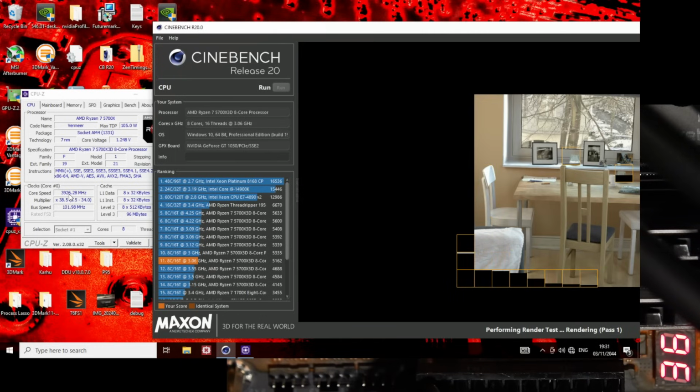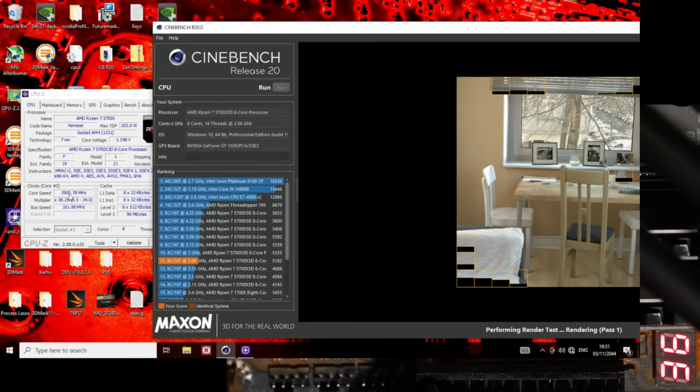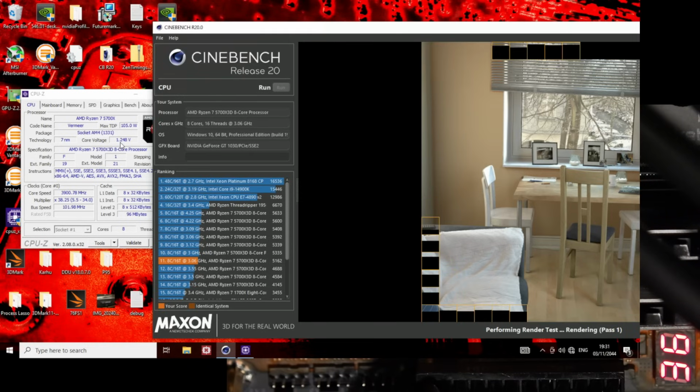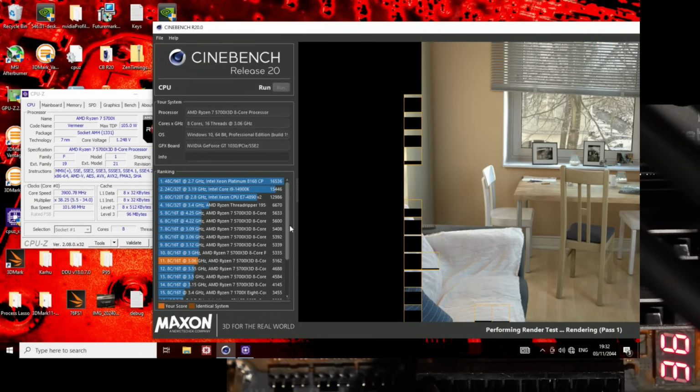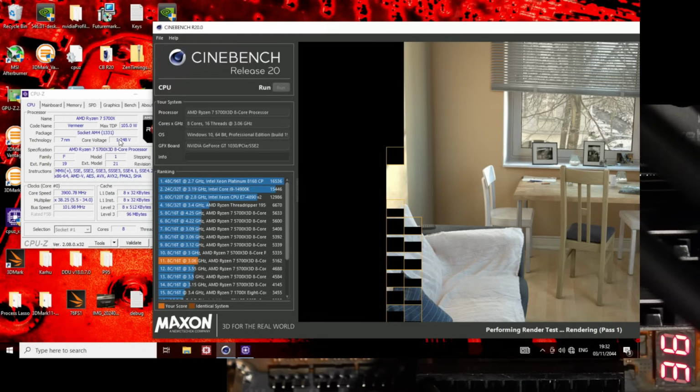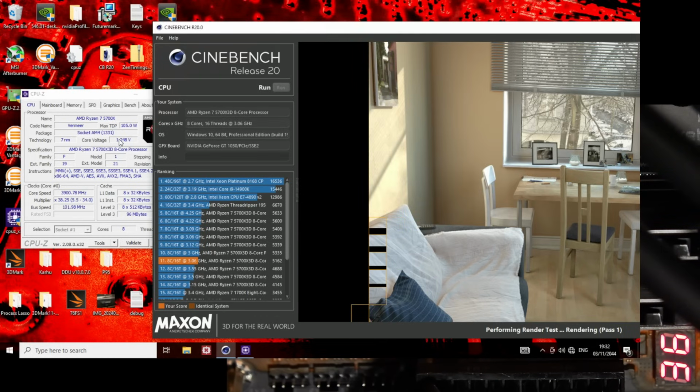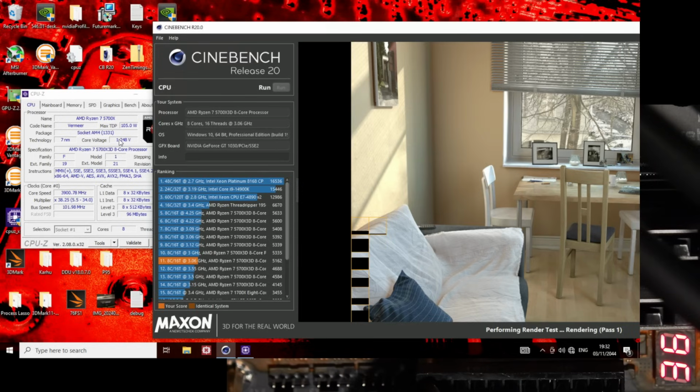At the start of this video, I showed you this CPU running 4.2 gigahertz at 1.2 5-ish volts, right? The core voltage was basically the same as it is right now, and we were at 4.2 gigahertz, and it was happily running Cinebench. That's how we got that 5600 points over here. And then when you're on the stock boost algorithm, you so much as dare look at the core voltage the wrong way, and it immediately drops the core ratio. Like, do not.